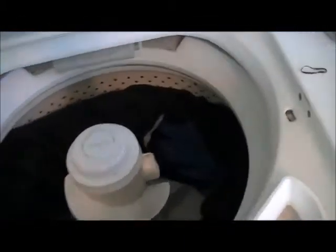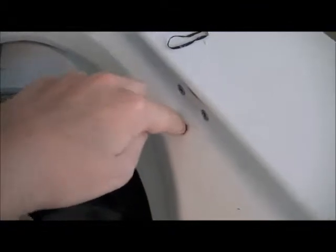The lid switch — can you hear the click? How this works: there's a striker on the door — what most people call it, and I call it a striker too — it's the thing that sticks out pointing directly at the switch, sticking into that hole. When you close it, the striker pushes down on the switch — that's basically how it works.